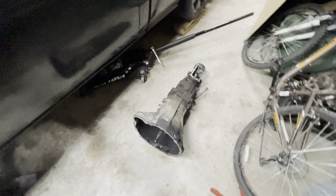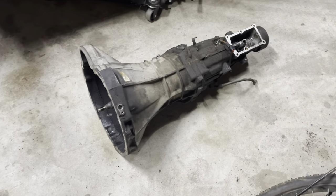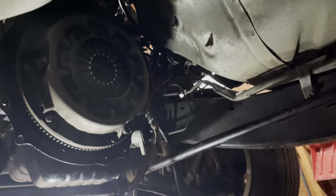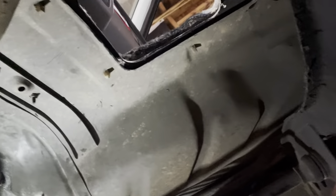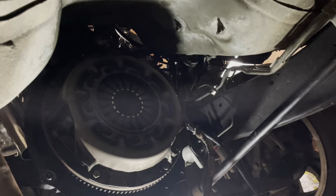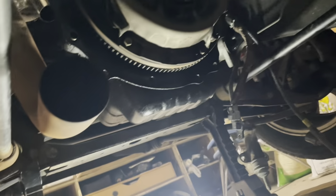Several hours later this thing's out. It doesn't look even that big but it's a real tight fit to get one of these out. You can see where I kind of drilled it out from under here — there's the back of the old KA. There's a hole in the floor, the drive shaft is just kind of hanging, and the carrier bearing is in pretty bad shape. Next is get that clutch off and take a look at things.